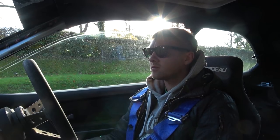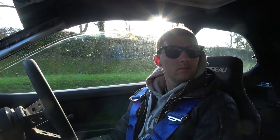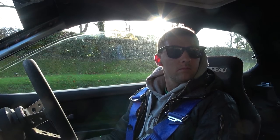Fair play, man. Yeah, sourced all the parts, done all the research for the wiring, because wiring was a nightmare going from a 46 to a 36 shell. Yeah, because obviously there's a lot more electrics in the 46. So you had to get quite a lot of things deleted: ABS deleted, all the traction controls deleted, DPF deletes, EGR deletes. Fucking hell, there's a lot of messing about. Yeah, it's quite a bit of messing about.